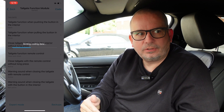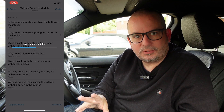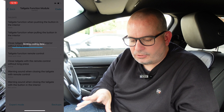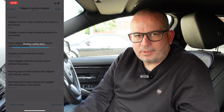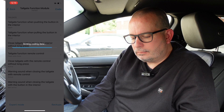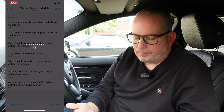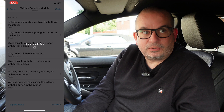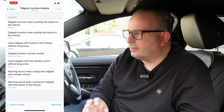All these standard functions - you can't really do any damage to your car. If you go into the expert mode and start messing about with that, it's a fairly deep dive code, and if you do the wrong thing you could get yourself in a bit of trouble. So unless you're an expert or you've got expert advice, just stick to the main functions. There's also a similar app called Carly that a lot of people promote with affiliate deals. Carly's a great app as well and a good tool - it's a bit more expensive and it's an annual subscription. Whereas with BimmerCode, once you pay for it you've got it forever and you can use it on as many BMWs as you want. I think it's about 30 quid.